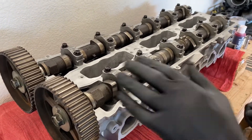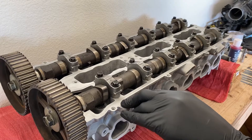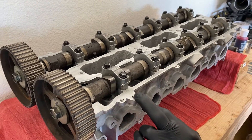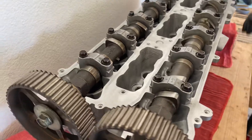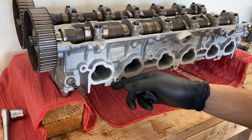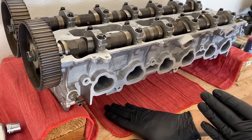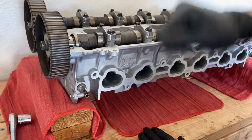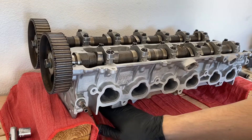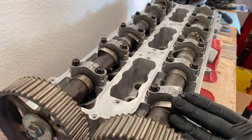On the intake side of the JZ, it's going to be anywhere from six thousandths of an inch to ten thousandths of an inch. I'm checking this first one here, and as you can see I have the head propped up on some pieces of wood so it won't scratch. The reason for this is when checking the valves and turning the cam gears, it pushes down on the buckets and opens the valves. If the head is just laying flat you could possibly bend a valve, so I like to have it elevated so nothing is in the way.